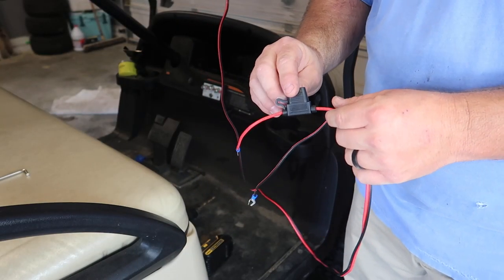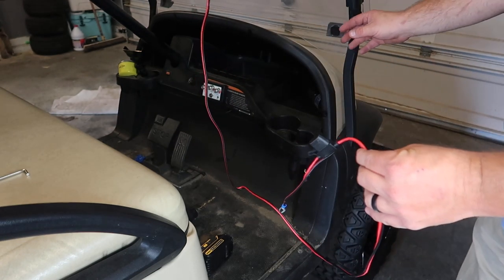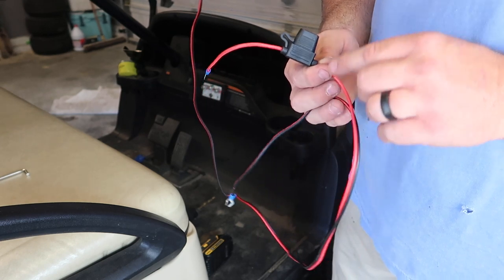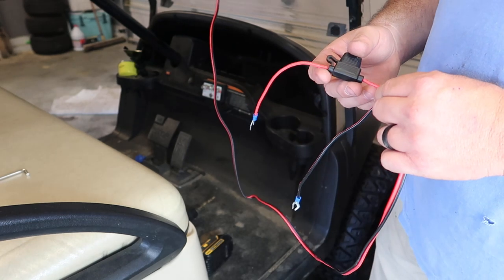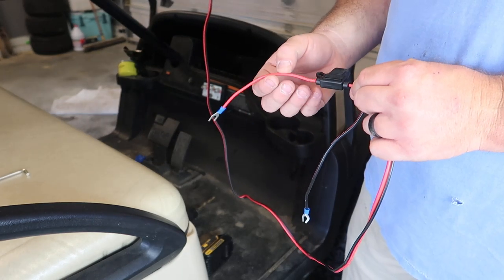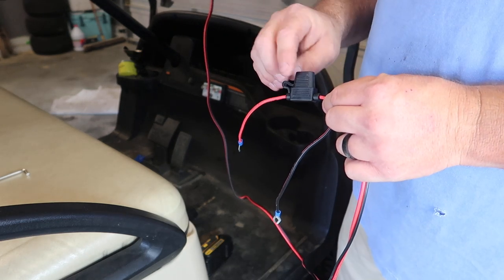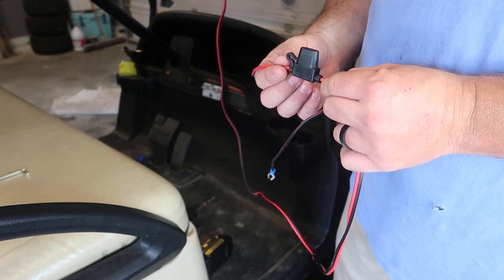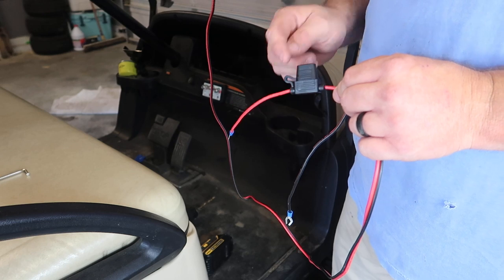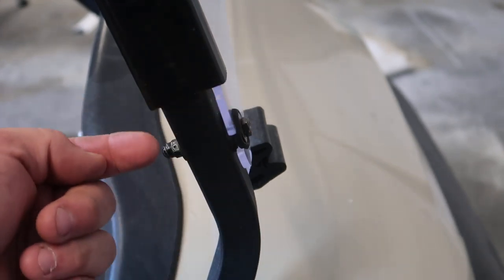This is your fuse and power leads that go to your 12-volt source. On this golf cart, I would like to feed these wires down the upright tubes on the inside, but I can't because of the fuse. I'm going to cut the fuse off and not use it. The reason is that in our last video we installed a 12-volt DC converter, and since we added a five-gang fuse block with a fuse panel system, I'm going to remove this fuse and use it in that fuse block instead. However, if you do not have a fuse block after your DC converter, you will need to keep this fuse. If you're running wires through the down tube, anything with bolts running through it could jam the wire, so remove those first.